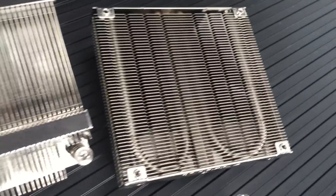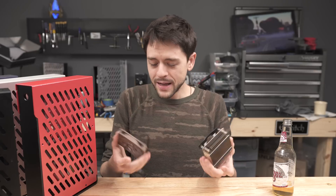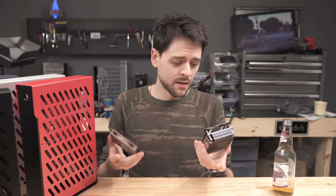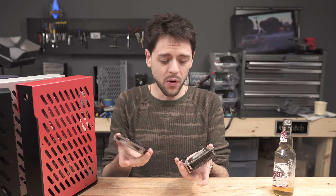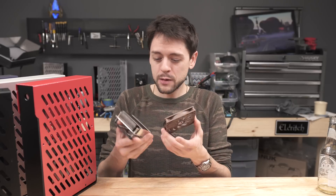I think the difference has to do with the fan, because the heatsink design is pretty similar. The Noctua has more fins and a heat pipe, and I guess that offsets any advantage the vapor chamber has on the VC45. That was pretty close — almost too close to call if we're talking about just the temperature data. But there are a lot of things about this cooler that don't hold up to the NH-L9i. So is this a bad cooler? Absolutely not. It just can't dethrone the king. Maybe with an update and some heat pipes it could, or with a much lower price tag I'd be tempted. But because — at least in America — it's more expensive than the Noctua, noisier than the Noctua, and not as pretty as the Noctua, I would have to go with the Noctua.